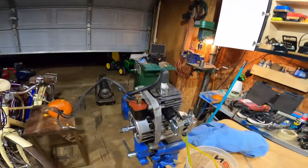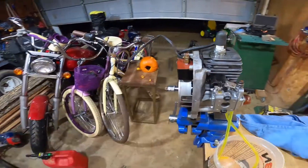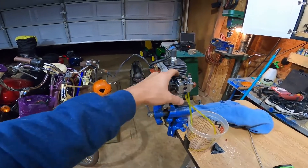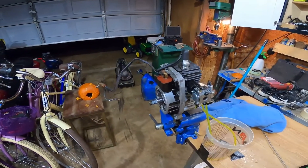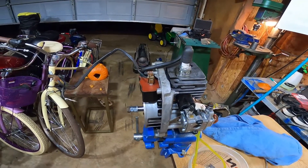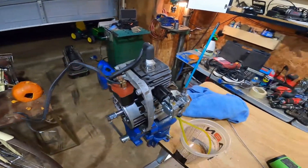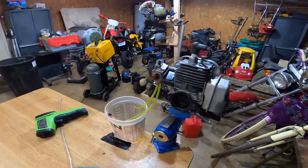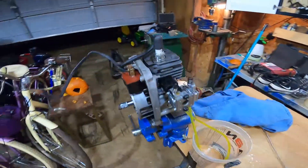Little recap — what did we learn? It eats primer bulbs, it's extremely unstable, it takes a lot of fuel just to idle, and I bet if we could flow even more fuel than this carburetor allows we'd get even more power. It ate my O-ring and developed an air leak, which we fixed. Nitro methanol is a wild fuel for a small-bore two-stroke. There's another guy doing this too — his channel is called Two Stroke Stuffing and he's actually working to build the world's most powerful 50cc two-stroke engine. He's making his own cylinders, custom piston designs — really cool stuff. All right, I'll see you guys next time.